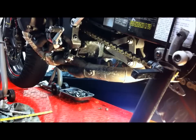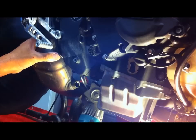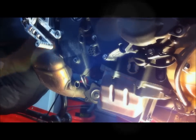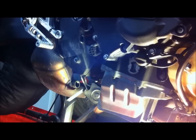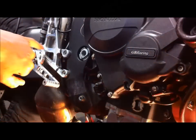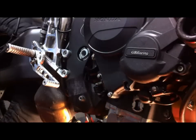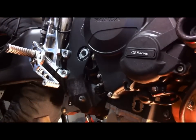That cuts very easily. I'll move over to the other side now just to do the last little bit. I'll have to do the last section with the hacksaw. That was relatively painless. Now I'll undo the clamp here where the slip-on joins the end of the cat and then I can pull the whole section off. And there we go.